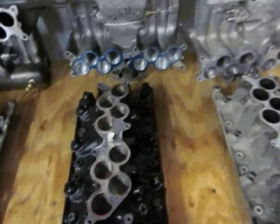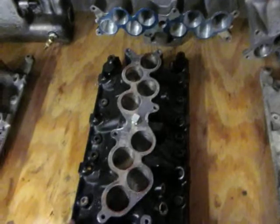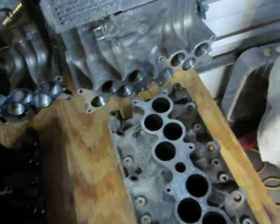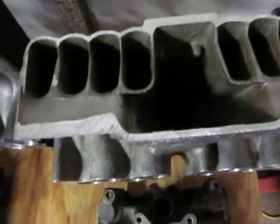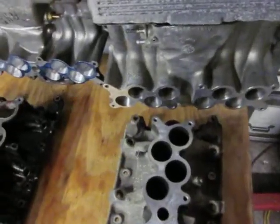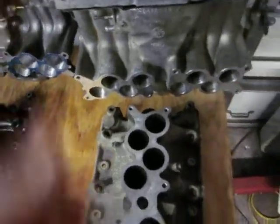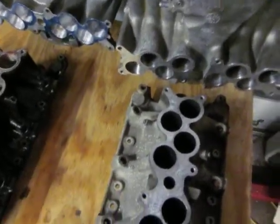This is the intake I had on my red car, Poodle Pecker. The lowers where it goes to the head, and actually the whole runner length on a factory one, is like 1.6 inches in diameter from where it goes into the inlet or the upper inlet up here. It's a rounded rectangular oval shape, and that's like I said 1.6, and then it stays that diameter all the way through as it gets into the lower — 1.6 to 1.65 in that area. Ford did a really good job of keeping all that roughly the same size, except for where it comes out to the head.